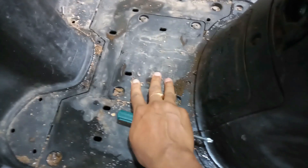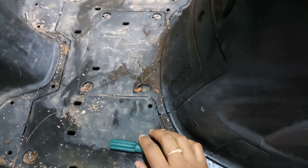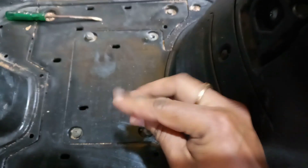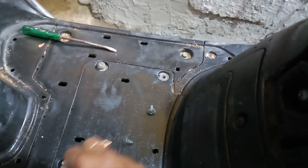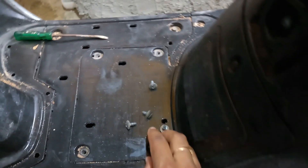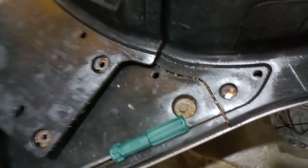This is the battery location. There are four screws — you remove this plate and this screw as well. Before that, identify the battery. Now I will remove these four screws and this plate. Lifting this gently, it is coming this way. After lifting this cover, the battery is here.